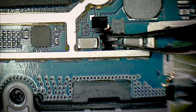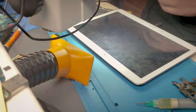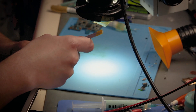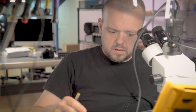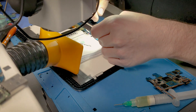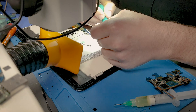Let's break this cap off and see if that makes a difference — I don't think so, the cap is already damaged. I left it on charge for a bit but it doesn't seem like it's going to come on. I also tried replacing the cap, but I don't think it's going to turn on. So you know what we're going to do — ISP on this. Soldering it won't be the problem; the problem is gonna be plugging this into Easy-JTAG when I'm ready to read it. Let's get this connected.